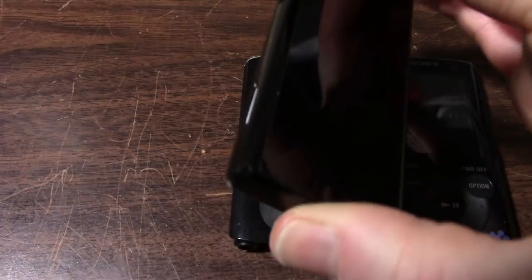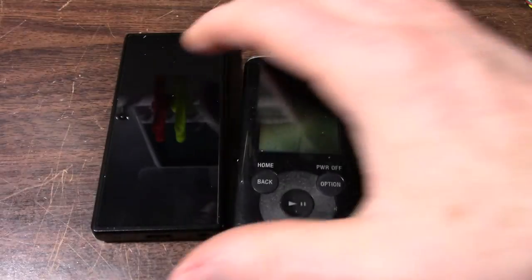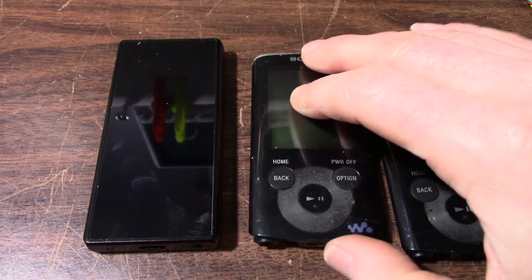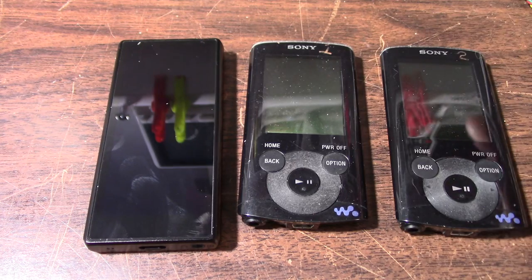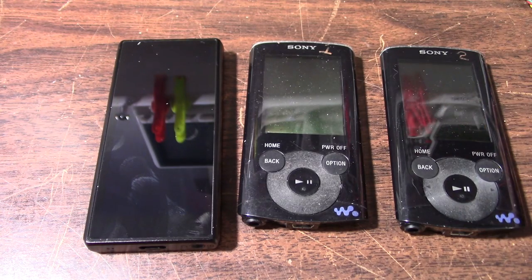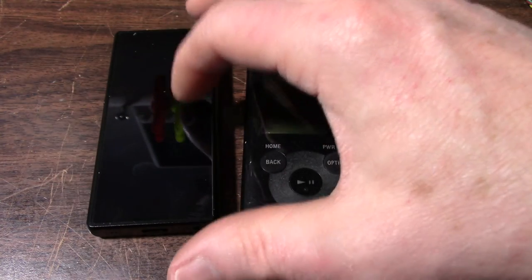With the card, you can buy a larger card — they're not very expensive — and I can fit my entire music library on one player. Another issue is the output level. These will drive cheaper headphones, like the older Walkman style 16 or 32 ohm headphones. But if you have a nicer set, I have a set of Sennheiser 68 ohms, and you have to turn these almost all the way up before you get a normal listening level.